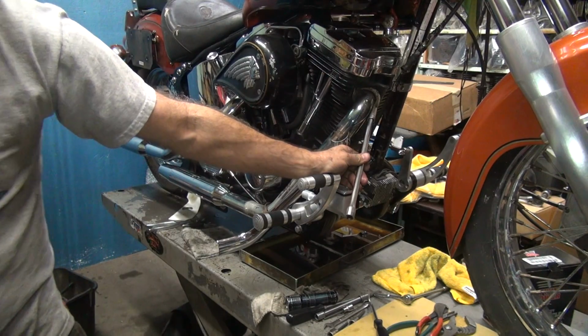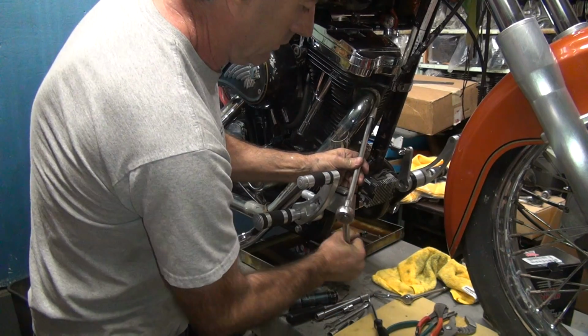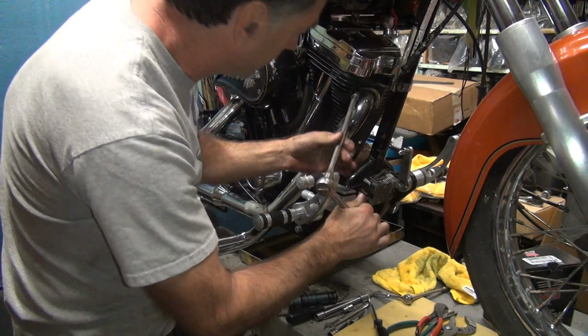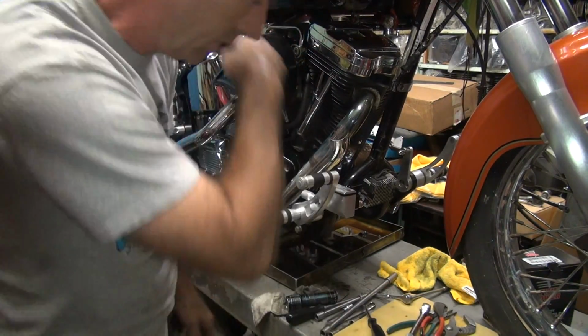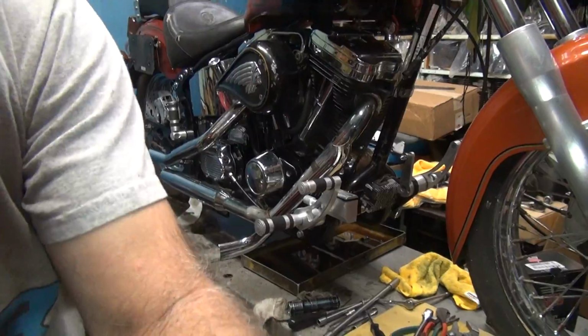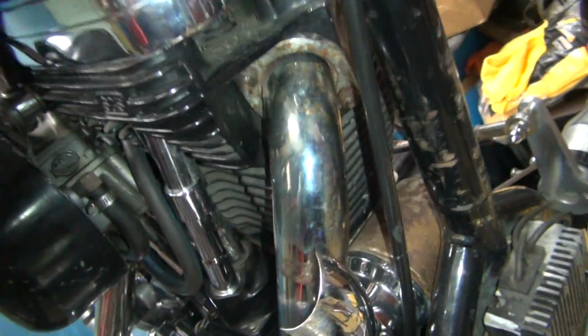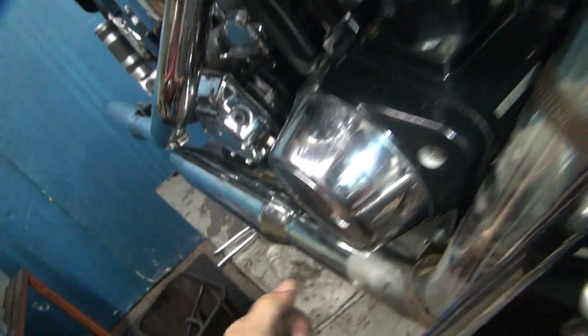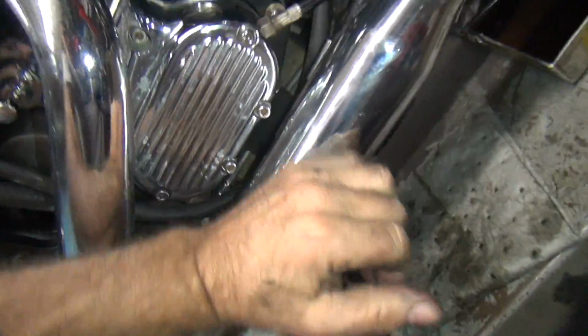Super tight, but tighten down. That's enough. If you over tighten them, all you do is bend the bracket flange up here. You just bend it in half. You strip out the nuts. All kinds of stuff you don't need to do. Doesn't need to be that tight. It's fairly vibration because of the bracket, the way they're made. Of course, you're hearing this vibrating too.